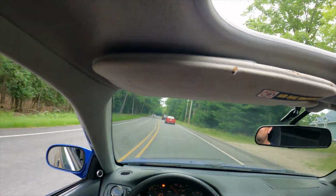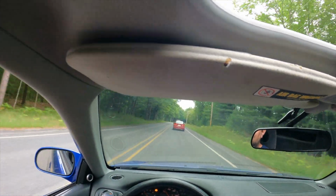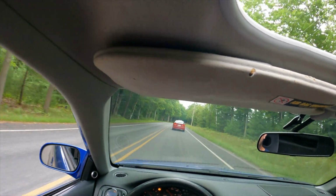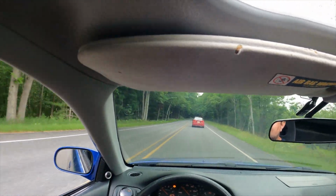When I'm on the throttle, it drives just fine. Just has the check engine light. I think that's partially because I unplugged the idle air control valve and didn't clear the code afterwards, so should be all right. Just a little jerky in the meantime.